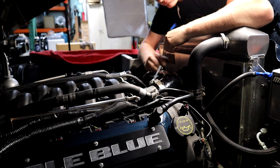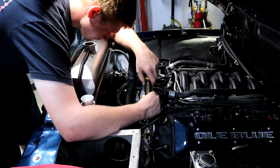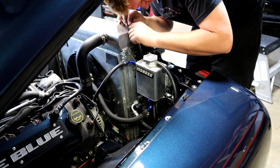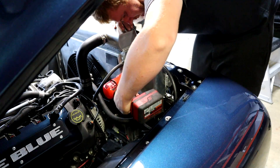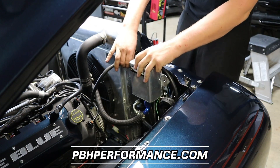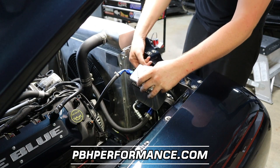For the next part of this video, we're going to have our technician Mike Chamberlain hop in here. What he's doing is clearing out the cold air intake and getting some of the hoses disconnected as we're going to be adjusting a few things. He's removing the degas bottle that we're going to be omitting from the cooling system altogether. This process is basically just unbolting it from where they had it, disconnecting all the hoses, and draining the coolant from the system safely, so it's out of the way and we can start working on the hoses themselves.